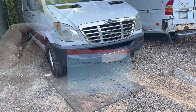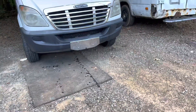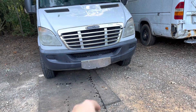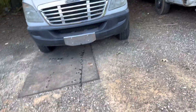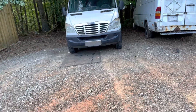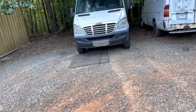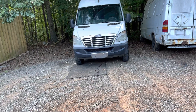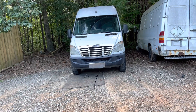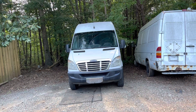One thing for sure — that oil leak from the oil cooler seals is pretty bad. Look at all those drips right here just from me pulling in. You can see the drips starting all the way from here. That's a pretty big leak — by the time you get somewhere, you're going to lose about a quart of oil. So that hesitation I'm feeling might also be due to low oil, and I checked the dipstick earlier and it was indeed low.